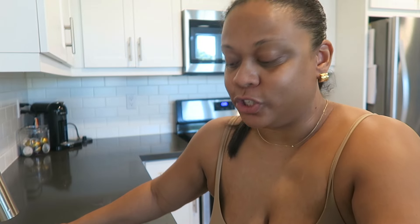My sink really doesn't smell good. The way that I clean my disposal is I run some hot water and then I slowly pour down some dish soap and I keep the disposal running as well. That just cleans the disposal — gets it all soapy and cleans everything inside. I learned that from a maintenance man at my old apartment complex when I was super young. You can also put ice down the disposal to help sharpen your blades, put some lemon wedges down there to help it smell good, and some baking soda. Lots of different ways to clean your disposal — this is just the easiest option for me right now.